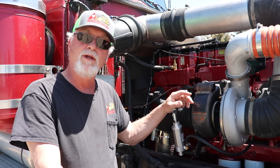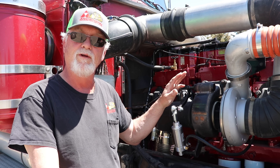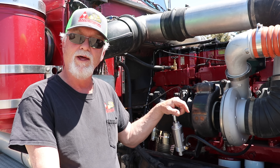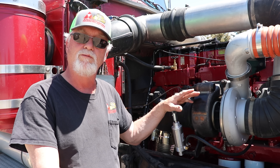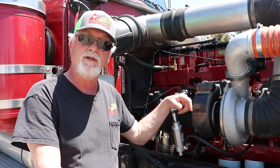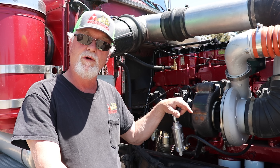When I put this one on here, at idle this will make about 2 pounds of boost on this engine. On my D9 it'll run about 5 pounds of boost, which has got to be good, especially if you're idling your truck a lot. More boost equals a better, cleaner burn on your fuel at idle — less slobbering and fuel dilution in your crankcase.